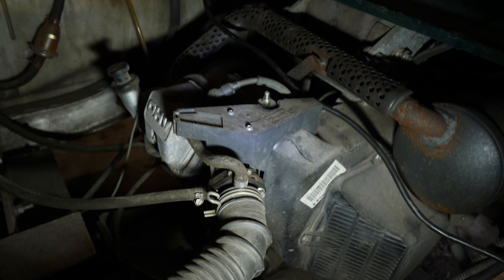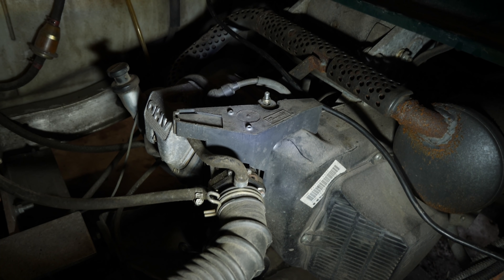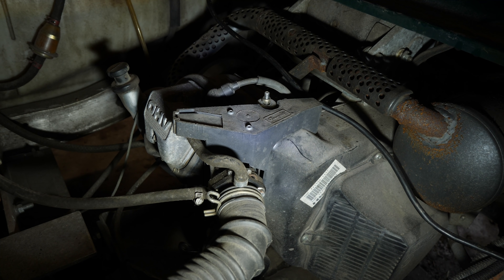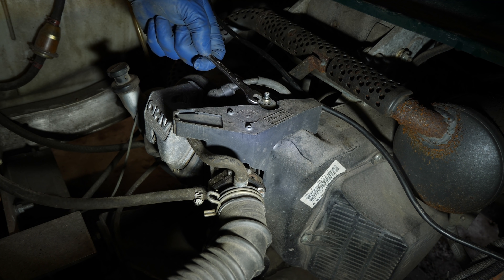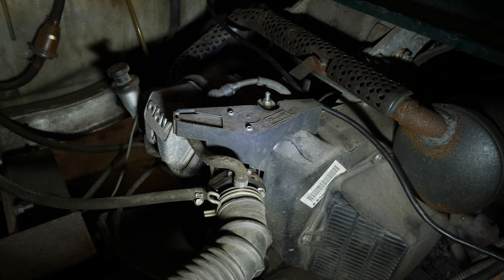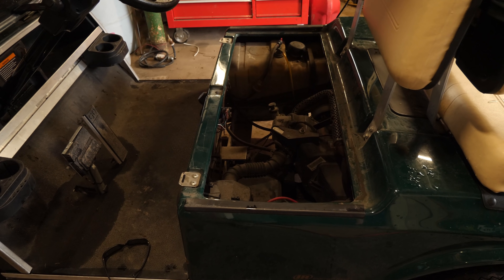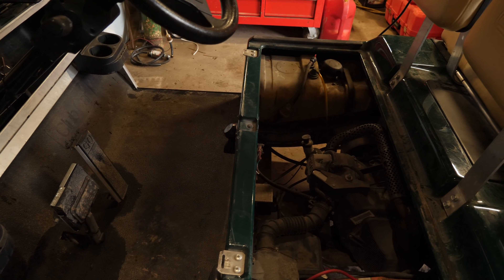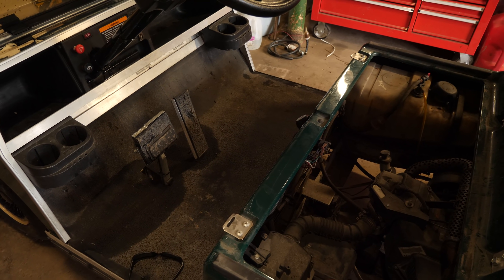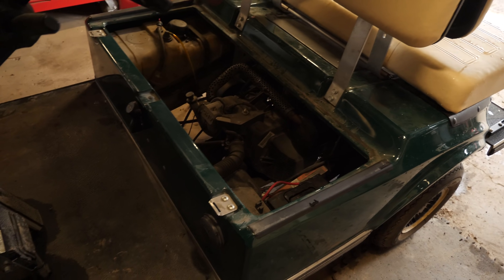Now we have pedal fluctuation. I gave it a little bit of pedal adjustment so the driver is able to manually fluctuate the throttle without having to worry about the governor kicking in. At the same time it's never going to self-regulate — it's always going to hit the rev limiter if you push it to the floor on flat land. Not much you can do for it. Let that be a lesson: adjusting the governor is not always a good idea, as this one has suffered damage.